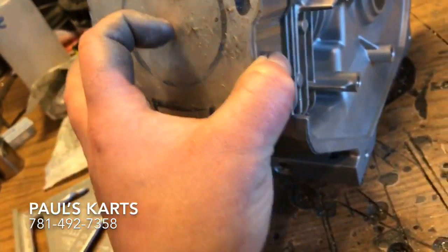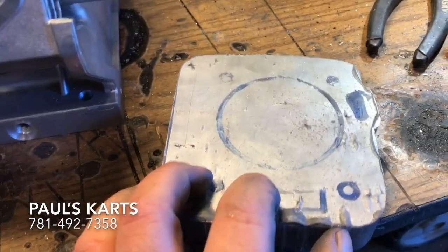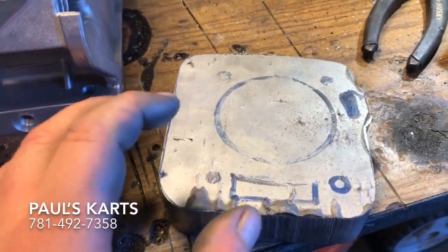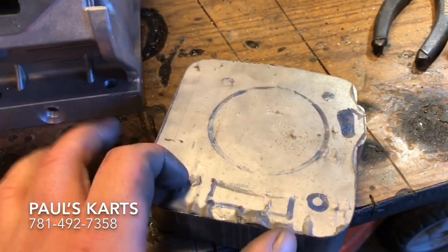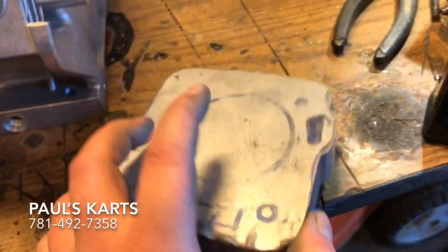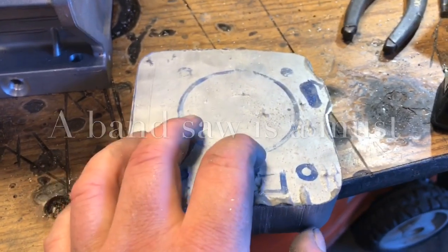You just don't want it looking all nasty after it's welded on. The way that I do the decking material is I take a head gasket, transfer that head gasket pattern onto the billet plate whatever size it's going to be, and then cut it out. It's extremely hard to do 1-inch plate. Done a couple of these in the past — last time it actually took me two shots just to cut it because I was doing it pretty primitively with a sawzall and a jigsaw. I recently purchased a band saw and made a stand for it, so I was able to cut this a lot easier and more square, which definitely helps with the sanding.